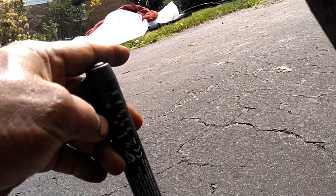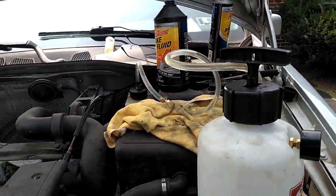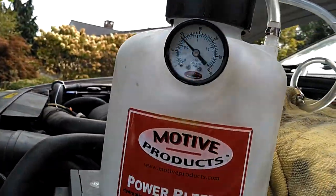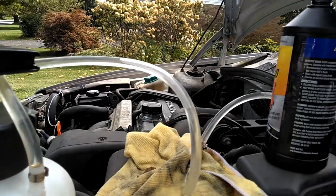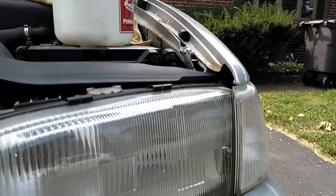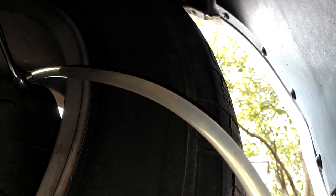You want to keep an eye on your reservoir and your power bleeder to make sure you're still pushing fluid through — mine had gone empty. I normally do between 10 and 15 psi to keep a positive flow. If you hear the bottle going empty you want to shut it down — you don't want to empty out your reservoir. I'm on my last caliper now, and everything is going well. All of them opened up and closed for me. This fluid is starting to look clear already, so I'm going to go ahead and close this off and test the fluid.